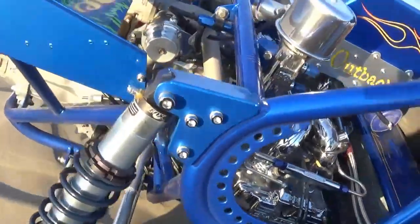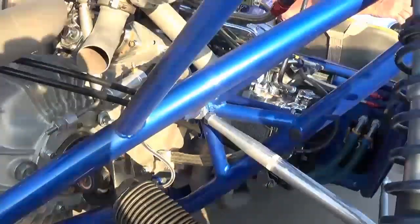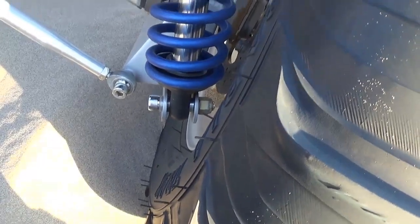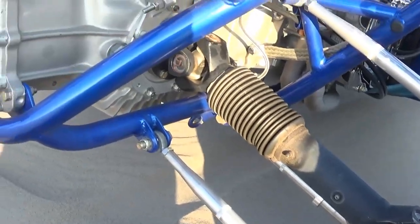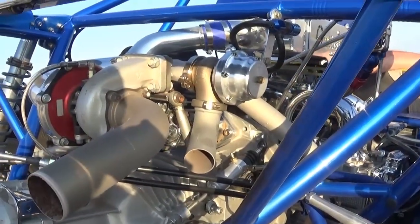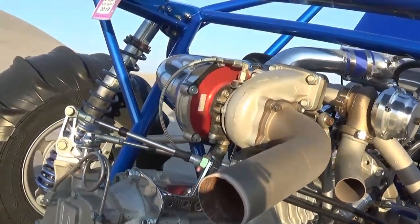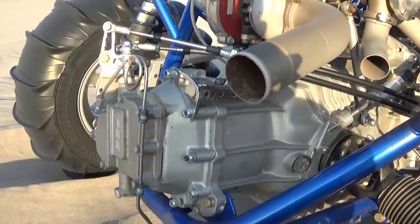Right. So the main time you're light and nimble and it rides good, and all of that counts, because one of these guys that burned so much fuel, it pogos off of every little bump. So all this gas goes whoosh. Then the floats come up, and fuel pours in, and black smoke comes out, and sometimes he makes it up the hill, sometimes he doesn't. Talk about rich. Yeah. He's already running rich. Now we're running flooded. Yeah. My other trick is to run super tiny Venturis, and I can run the carburetors exactly the way I ran them without a turbo, with a turbo, and it works.